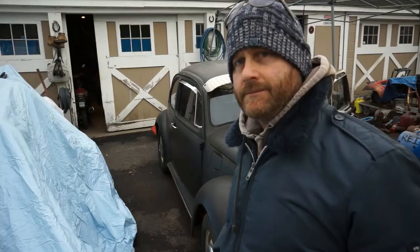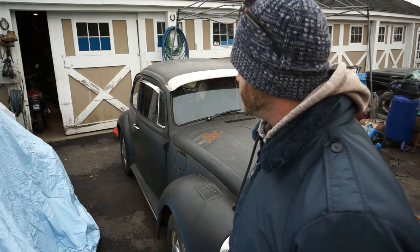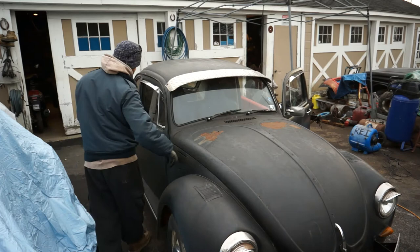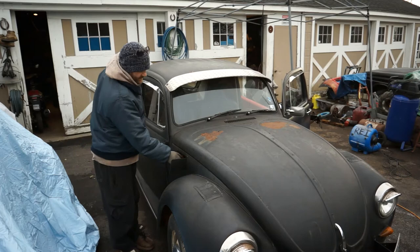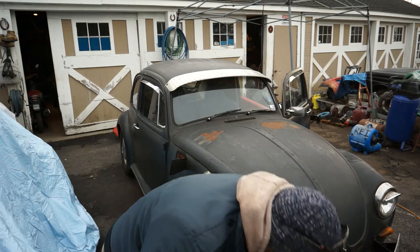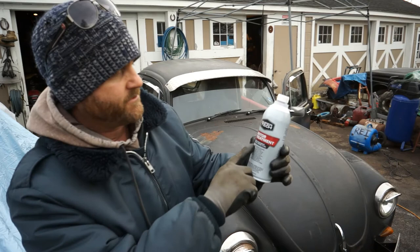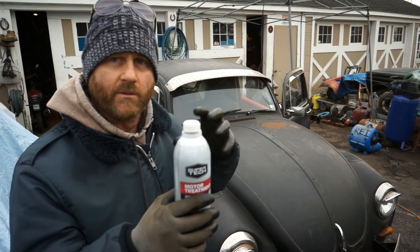We just got this bug started, which I'm ecstatic about! I thought it was going to be a major wiring issue, something extremely major as to why the guy was selling the car, but I'm happy. We're going to pop this fuel door - there's a little rope hoop kind of right here. It looks like a pull cord for a lawnmower. You just pull it lightly and the door swings open. It actually doesn't smell that bad. What I'm going to do is use this Supertech motor treatment that I get at Walmart - they're not paying me to say this, but it's motor treatment for cars, diesel, and oil. You can put it in the oil, crankcase, whatever. I always pour it in the fuel tank - it's like a stabilizer, fuel and injector cleaner all in one. It makes that old gas good again, believe it or not. This stuff works - it's almost five bucks a can and it'll do up to 12 gallons.